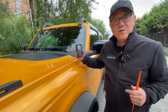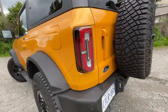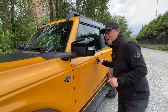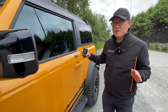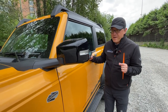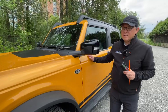The reading here is 119 microns. Most paint thickness is between 100 to 180 microns, so 120 is about the right average for all vehicles. The front fenders read 138 — a little bit thicker there — and the door reads 130 and 120. That's pretty good; it's a little thicker than what I find on typical Toyotas, which are around 110 to 115. It's good to have slightly thicker paint because if you're going off-roading through forest, you want the paint to be thick enough to withstand those situations.